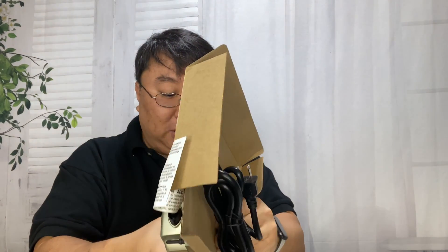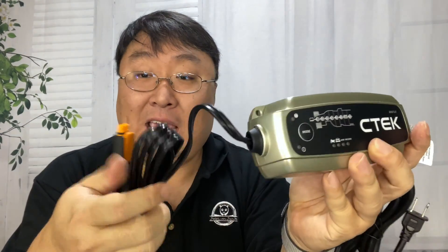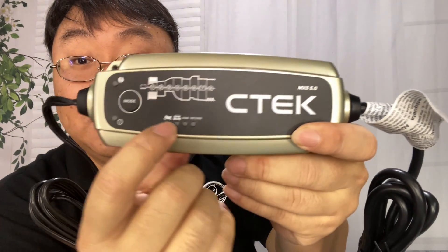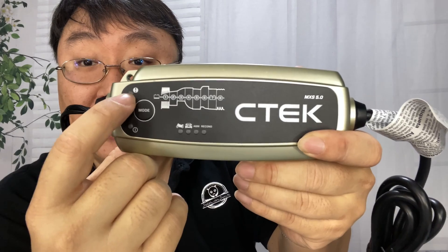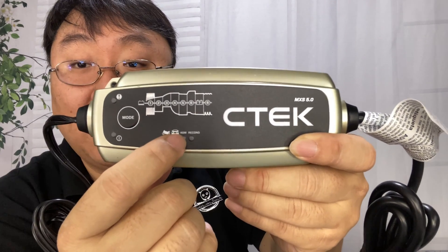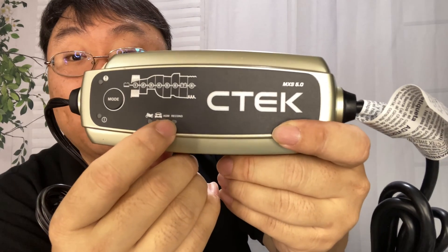We also have the charger, and what's unique about this charger is that it has a little bit more limited functionality. It's still a capable charger — you can see a pretty long cable with a quick disconnect, and a pretty long two-prong power cable. On the front we have a mode button to cycle through modes, a power light, and a fault or alert light. What you get is motorcycle or vehicle — I think 6 and 12 volts — and AGM for AGM style batteries, which I think covers Optima or Odyssey brand. And then we have recondition.